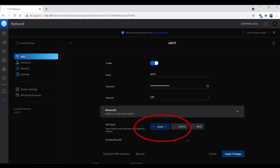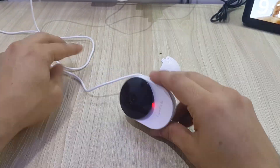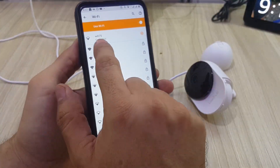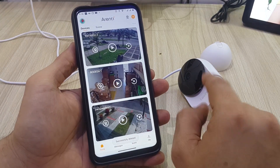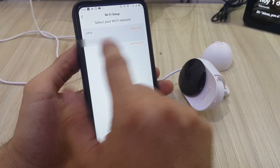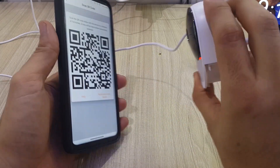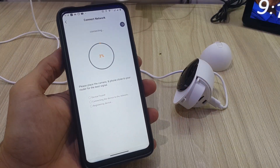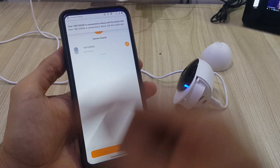Before ending this video, I decided to make a final test. A lot of people have complained about this camera not being able to connect to a 5GHz network, even on setup. So I disabled the 2.4GHz network at home and tried to set up the camera as if nothing had happened — and it worked, normally, as if I had done it with the 2.4GHz network enabled. I wouldn't worry much about this, as 2.4GHz networks have greater range, and especially with these little devices that sometimes are not going to be so close to the access points, I would rather use 2.4GHz. Each camera only uses 1.5 Mbps tops, so 2.4GHz networks will do just fine.